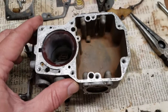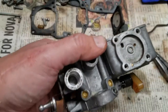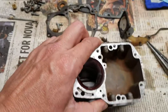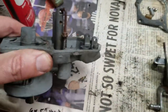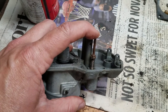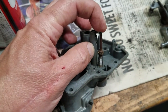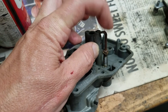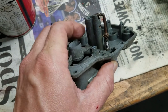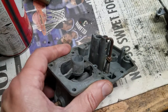We had this in the ultrasonic cleaner and it's not perfect but it's way better. All the solids are gone, still some staining, but it cleaned up really nicely. The shaft doesn't seem to be loose, which is great. The other problem I found was that the accelerator pump rod was totally seized — stuck in the down position. I couldn't budge it even with pliers, so I ran it through the ultrasonic a few times, worked it quite a bit, and now it moves freely. It still sticks down occasionally but with repeated use and some CRC spray it now works as it should.